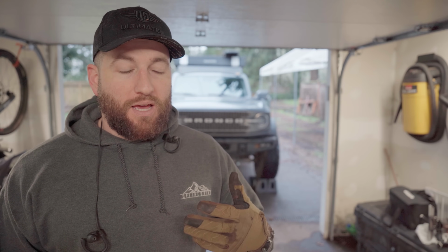That's wild. So anyways, since I didn't clamp off the boots and they weren't sealed, that allowed water to get into the boots and eventually into the steering rack itself. So the steering rack is waterlogged. So I need to take the steering rack out. I need to soak it with some penetrating lubricant, dry it out as best I can, and then put it all back together with the new tie rods and new boots.